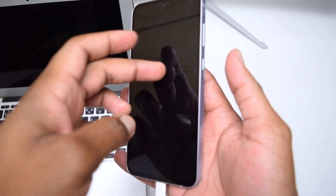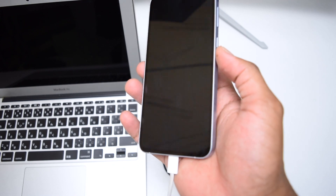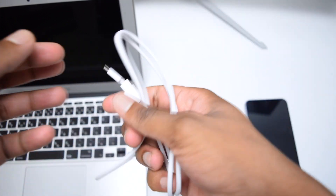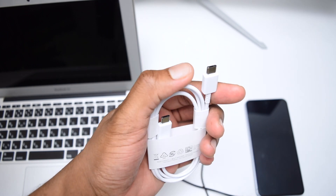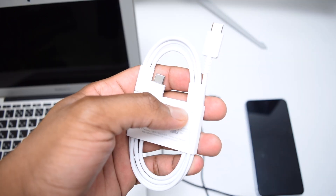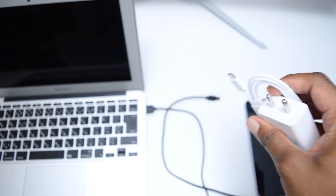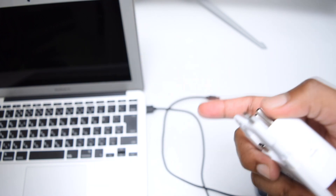If you don't see the charging circle indicator, your phone may have a faulty cable or dock. Disconnect it, wait 15 to 20 minutes to confirm it's not charging, then try replacing the cable with a different USB-C cable — it doesn't need to be new, you can borrow one. Connect it to the same dock first to see if the problem is in the dock or the charger, then try a different dock if needed. If the phone doesn't have enough juice it will keep getting stuck in that boot loop.